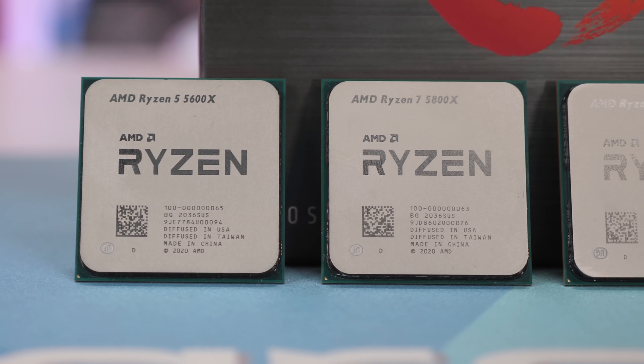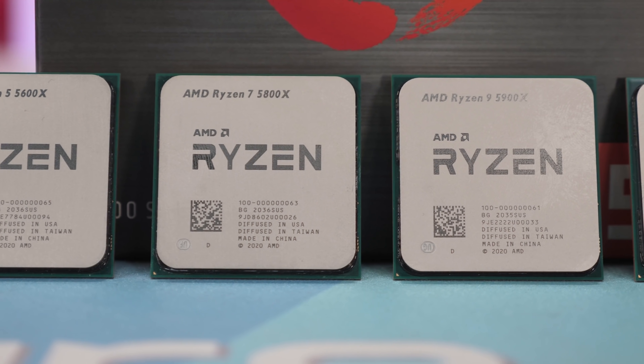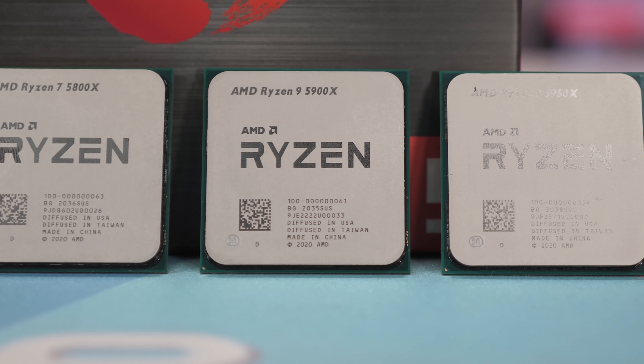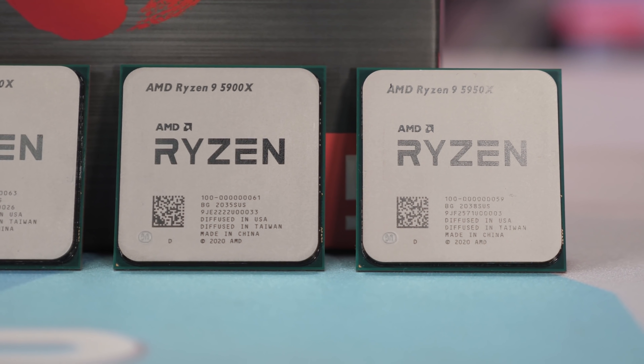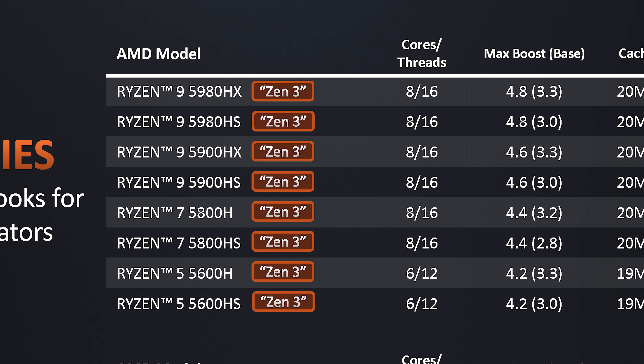There are also some minor clock speed differences. The Ryzen 5 5600X clocks 200 MHz higher in its boost state than the Ryzen 5 5600G, despite the 5600G having a higher base frequency. Similarly, the Ryzen 7 5800X clocks 100 MHz higher than the Ryzen 7 5700G. It's interesting that AMD don't appear to be using the absolute best Cezanne silicon available for these desktop APUs, as we know the same die used in mobile parts can clock as high as 4.8 GHz, which would have enabled clock speed parity with the desktop CPU line. As these are OEM parts, we don't have any pricing yet — we'll have to wait until the DIY launch later in the year, but there will be an interesting choice between a Ryzen CPU or APU.